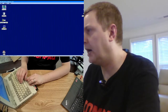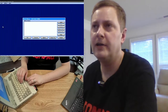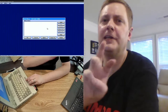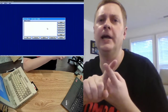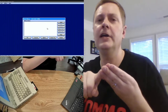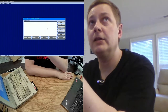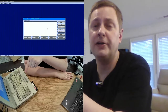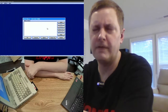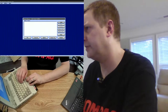If you get a 150 megahertz from a LTE 5400, I'm pretty sure you can put that in any member of the series, because there's basically three different motherboards that go with these. You've got one for the 5380, then you've got one for like the 5000, the 5200, and the 5100, and then all of the rest of them use a different motherboard. And I have taken a 120 megahertz processor and put 150 megahertz processor into a 5000, and it worked. So I think that you can basically swap them out. As long as you set the jumpers right, you should be good to go.